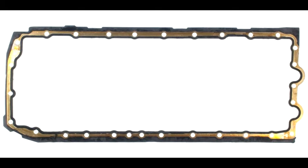The first of five categories we're going to talk about are gaskets, seals, and guards. Starting with the simple valve cover gasket — these can wear over time and leak oil on any vehicle, so simply replacing this should be fine. The lower oil pan gasket is typically a long-term wear item, but like any gasket, it does eventually wear, and again simply replacing it, as long as it's properly installed, you should be good to go.